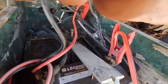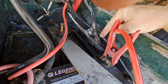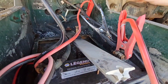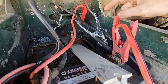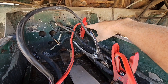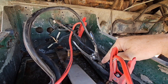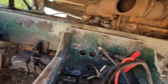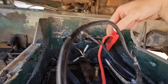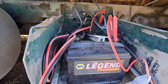So this is the positive battery cable and it's totally damaged. I just stole the battery out of my Jeep. I took a jumper cable and jumped it from this terminal to the other battery terminal for the second battery, bypassing that. Then this black wire right here was busted off, so I used the black side of the jumper cables to jump to that solenoid.